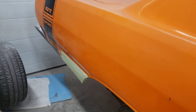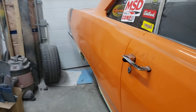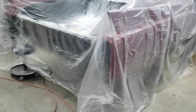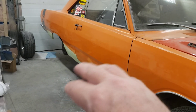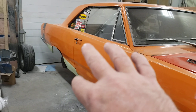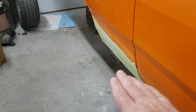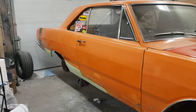Now if we were doing the whole quarter panel I wouldn't need that one — we'd flood the whole quarter, block the whole quarter until we were happy, then put a couple coats of Super Build or high build or 321 which I really like, depending on what we're burying and how we want it to stick. On this car we went with G2 Feather Fill. This car had a lot of trauma and it was crazy — this is the flattest car I think I've ever done. For those who don't know, it's a '63 Caddy, there are a lot of videos on that. But for this car the rest of it was done very old school — I imagine there's nothing on it but a bunch of filler, a little bit of lacquer primer, and orange paint. So we're just going to go up to what they did, paint from the line down. Once again, if you subscribed to the channel, thank you so much.